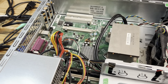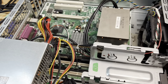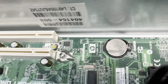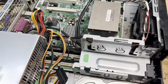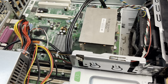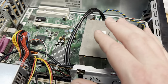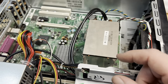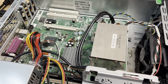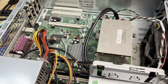How did I get it working so I could figure out what kind of processor it has? Well, after taking everything apart and making it really simple, it still wouldn't beep or do anything. I cleared the CMOS — we've got a switch and the battery and all that good stuff. Still wouldn't beep. I've never seen a reseating of a CPU make a difference in my personal experience, but let's give it a try. So I took the heatsink off, took the processor out — sure enough, it's a processor. Put it right back in there, closed it up, and sure enough it turned on and started beeping.